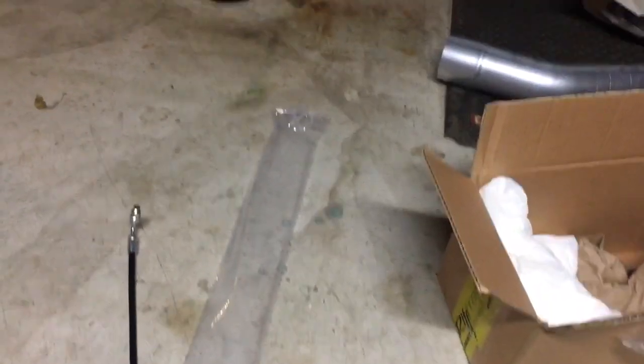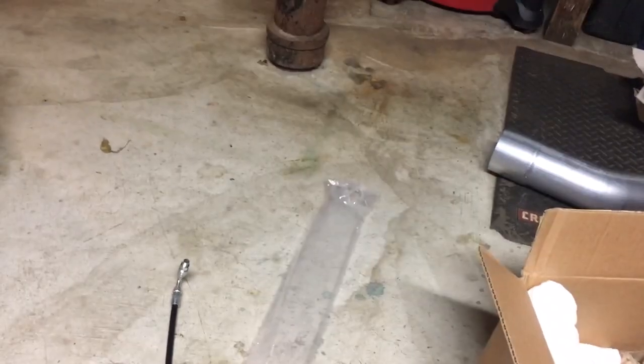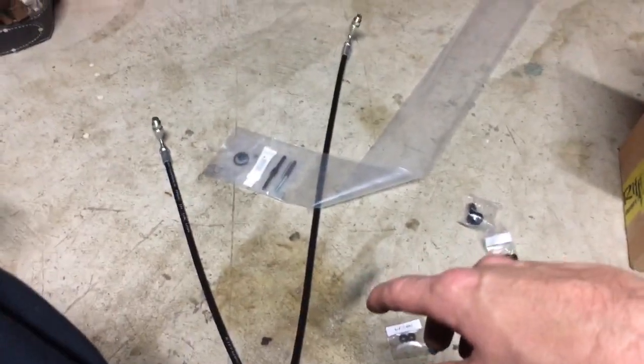But I'll probably do a video of it running after I do these upgrades and see how I like it, but it really does make a lot of sense to me to have a return fuel system instead of just the fuel going through the head and just hitting like a wall. This will at least allow it to flow in a circular motion, and will keep the injectors cooler, and I understand that it should improve the life of the actual injectors.